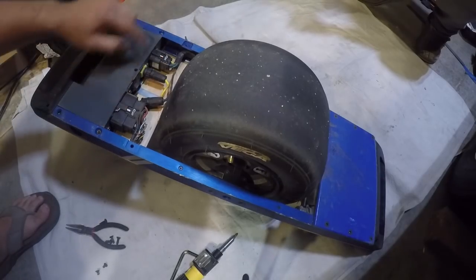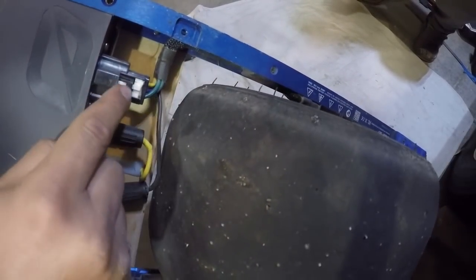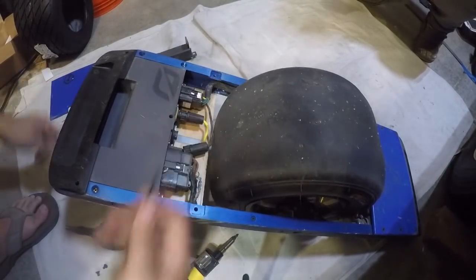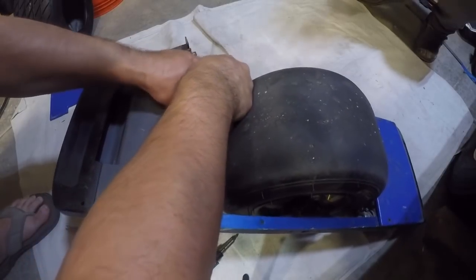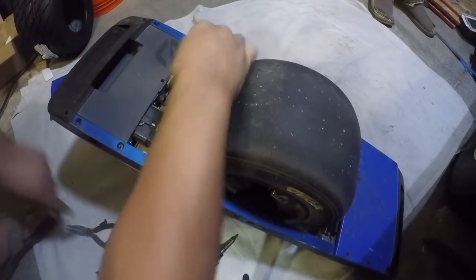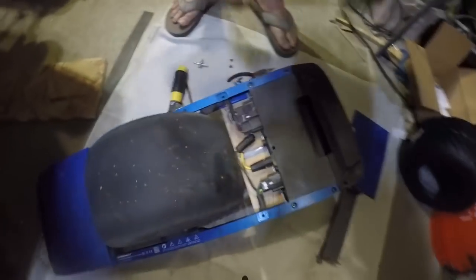These tabs — pull the tab down, push in that black piece, and then you can grab this whole thing here and wiggle it up. I like to use something blunt — I don't want to use anything sharp — so I use something blunt to not damage the plastic. Just push on it, push it down and wiggle out.